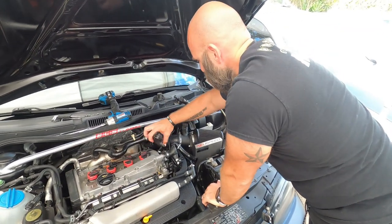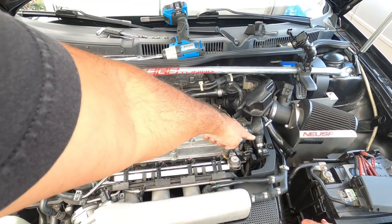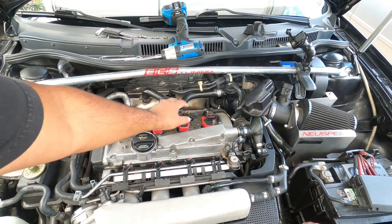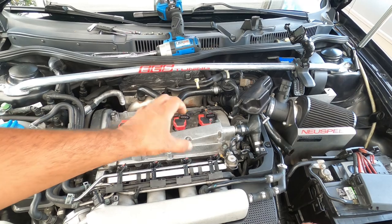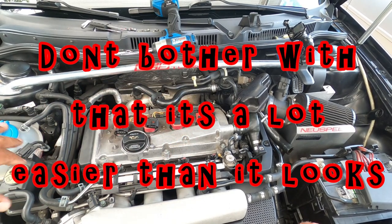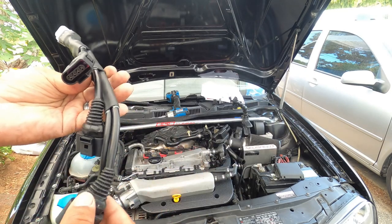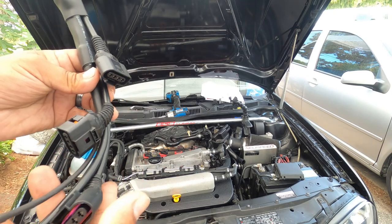There's the vacuum reservoir and here's the PCV. We just unbolted it from the hockey puck which is on the turbo inlet pipe. That now exposes the wiring. We unplugged everything we need to unplug. Now very carefully, you're going to unravel all of this towards the back and cut the black tape off - do not cut the wiring. This is the brand new harness from ECS Tuning. As you can see, it's a huge upgrade from the factory harness - everything's shrink wrapped with heat shrink and upgraded rubber, so less chances for it to get brittle and break.